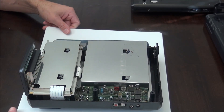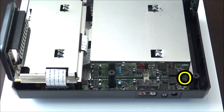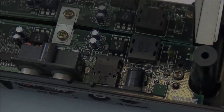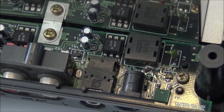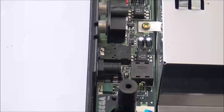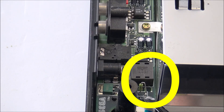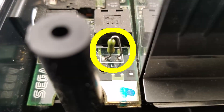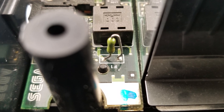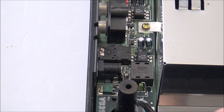Turn the Sega CD around so you can see the backside. Located right here is where the Pico fuse is — a small 2.5 amp fuse. Here it is again outlined in yellow, and here it is from a side view where I'm pointing with the screwdriver, also outlined in yellow. This is the fuse that usually causes issues with no power for your Sega CD. When these fuses blow, it cuts off all power to the Sega CD.